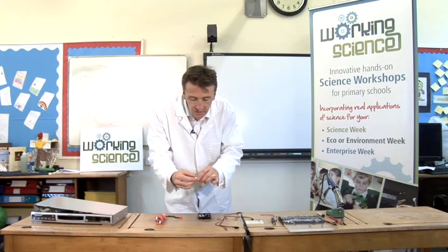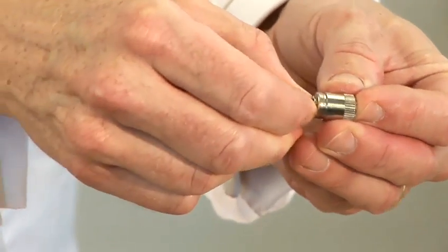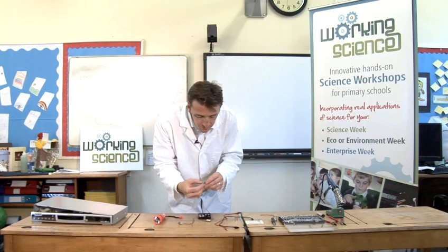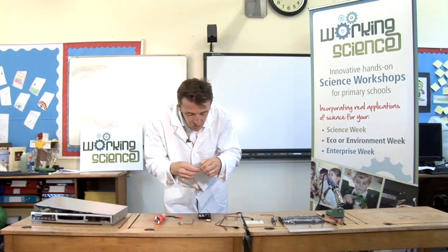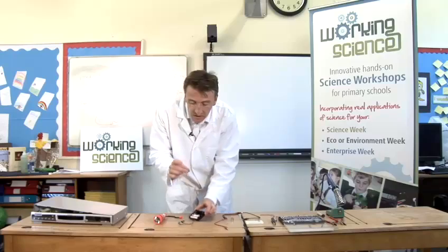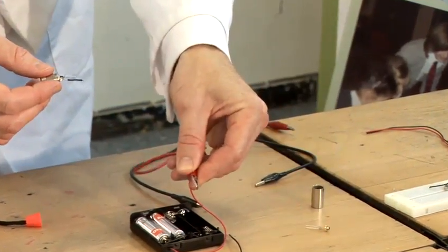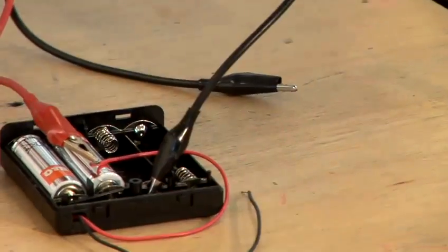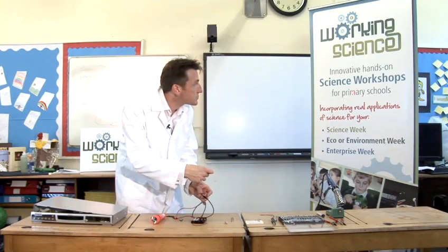If you take one of these laser bodies apart, it gives you a gap where you can put the laser diode that you've taken out of your DVD player. Put it inside — that gives it good thermal contact so it doesn't get too hot when you turn it on. Then you can connect the laser diode to a battery just to check that it works. These laser diodes work with three volts, which means you need two batteries. Just connect one end of the batteries to one end of your laser diode, and the laser diode should work.